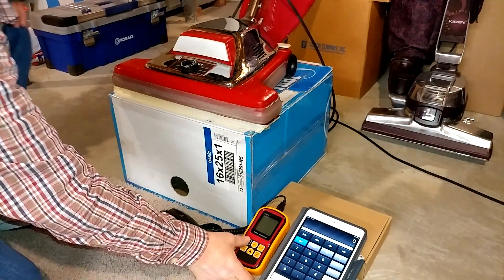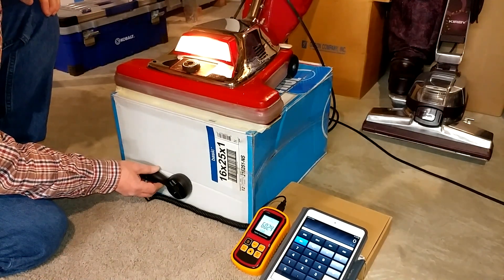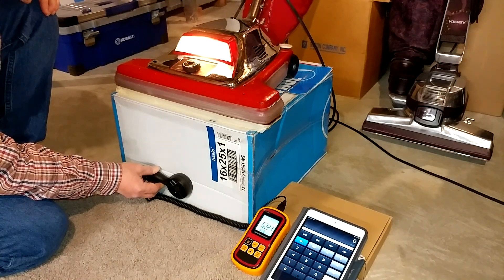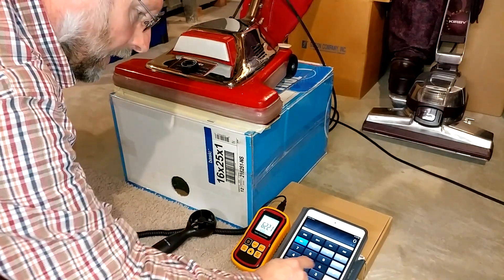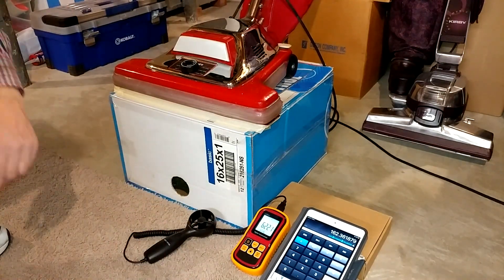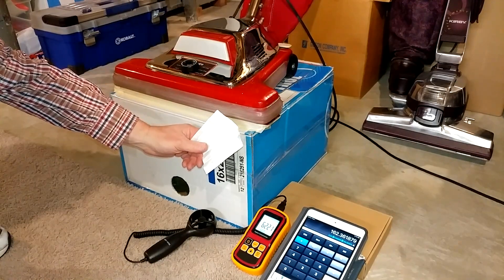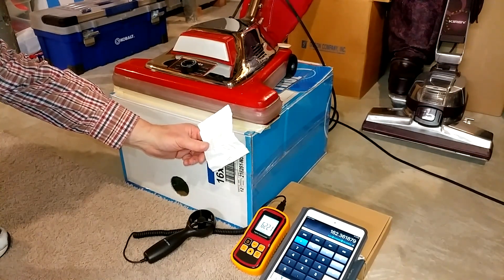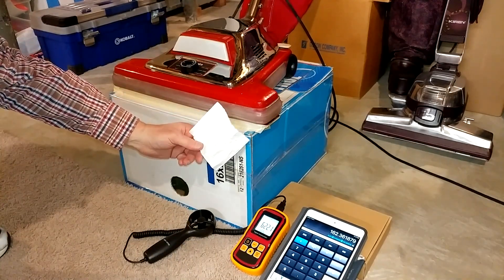What are we going to get? It looks like the answer to that is definitely yes. That bag is so fiddly. Look at that — 162. You're talking like 17 CFM more, just by trimming off a little bit of the fill tube and taking a little extra care to make sure it's installed as far down as you can possibly get it. I'll leave this up to you whether or not you want to trim this much off, but it really works for me. That's quite an improvement compared to the SC-888, where I did not trim this off.